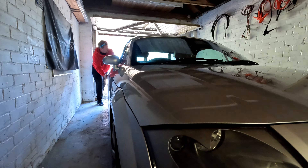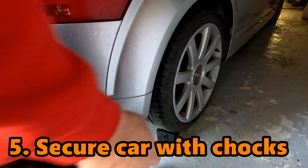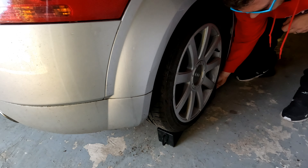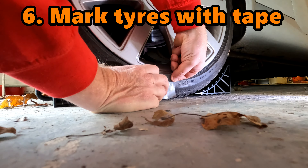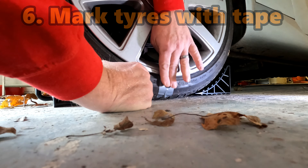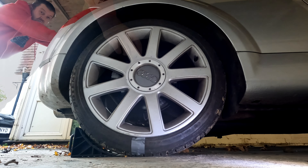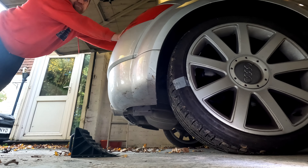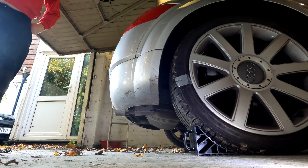Instead I'm going to secure the car in the garage with a set of wheel chocks — I feel this is the best way to prevent movement while keeping the brakes off. I also go around all four wheels once I have the car where I want it and put a piece of tape on the side wall marking where each tyre is in contact with the ground. Then I come into the garage once a week, remove the chocks, and roll the car backwards or forwards so that the tyres have moved 90 degrees, which allows the car to not rest on the same point of the tyre all winter and risk perishing.